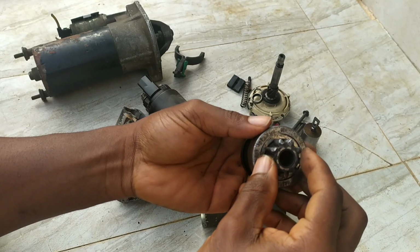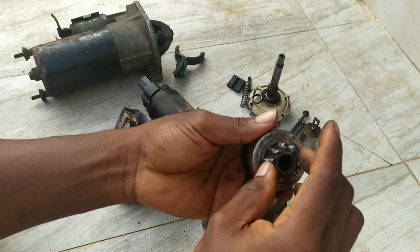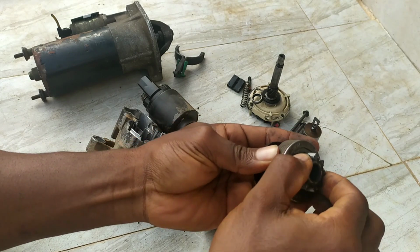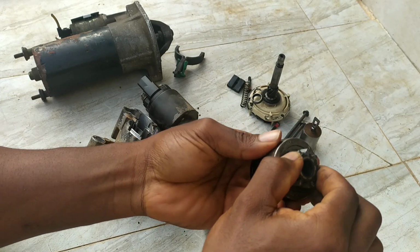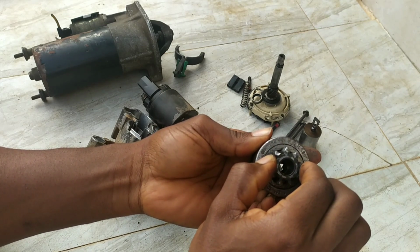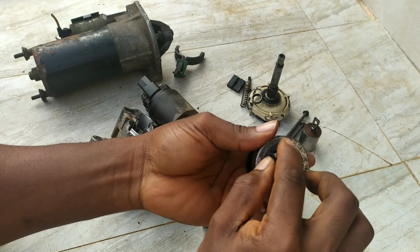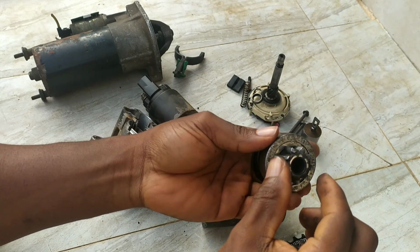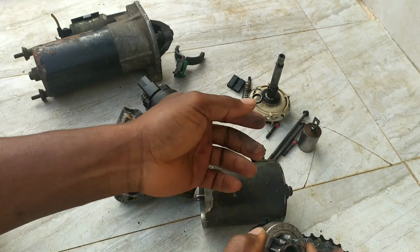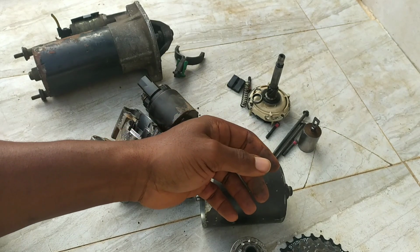So with the symptom I was getting and with all my investigation, I realized that this wasn't actually locking completely in one direction, in the direction which will enable the vehicle to start, and that was why I could hear the starter motor turning, but the engine wasn't turning. So I'll be replacing this portion right here with a used one. So follow me along.